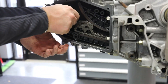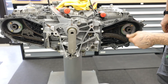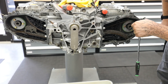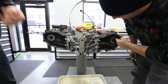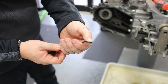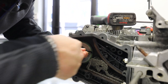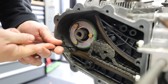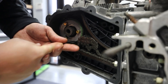I start with two bolts like this. We have to go search for the 10mm — this is the most common tool in the whole shop. What we're doing here is we start to run this gasket in, and just as it starts to bulge out, you take the seal installer — a non-marring spoon we talked about in a previous video. You take that and push this guy in there. Remember it's magnesium, so you want to use something really, really soft, because if you tear the seal, everything comes apart.